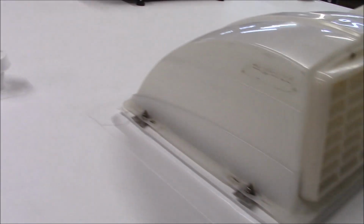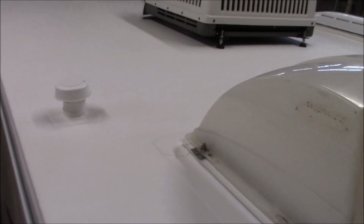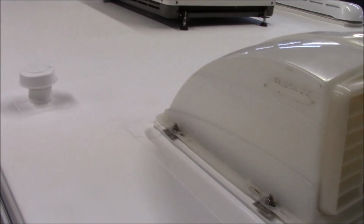I made all these pieces. The RV industry doesn't want to take the time to put the roof on properly, and that's why they all fail. They just want to take everything, cut a hole and screw it to the roof, and then slobber it without self-leveling, and then tell you to go back and put some more on. That's ridiculous. You don't do that on a commercial application.